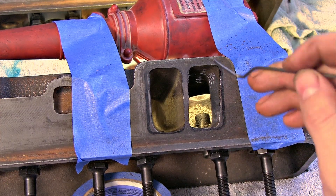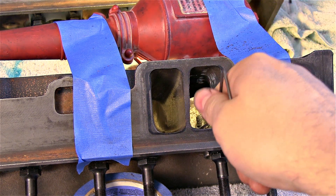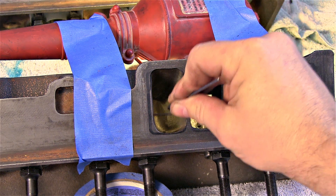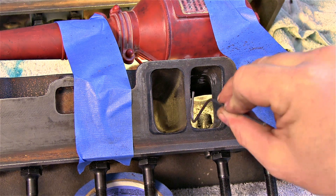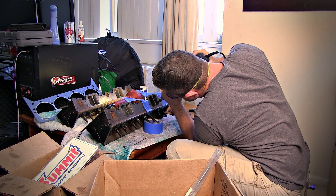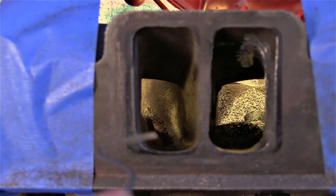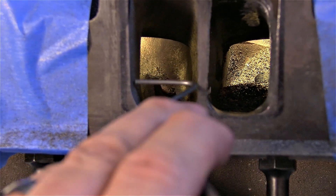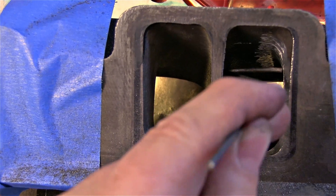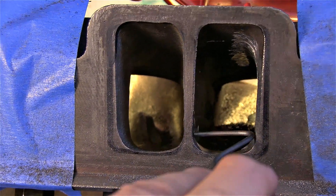Basically what I'm doing is taking metal off the side and the roof. I kind of eyeball it, put a straightedge down until it's flat all the way down to the valve guide. I go on the sides and measure as I cut material out. Once the template passes through like it does on the finished one, I know that section is right and then I start blending back into the bowl. I finished the first pass opening up this area — it's a rough cut — and I checked the clearances with my redneck tool. I cut some out and stuck the template in until both sides have about the same clearance. That's good enough for a street port.